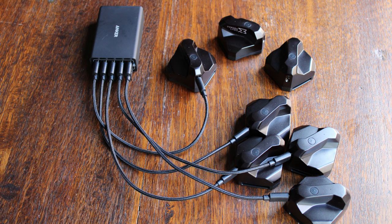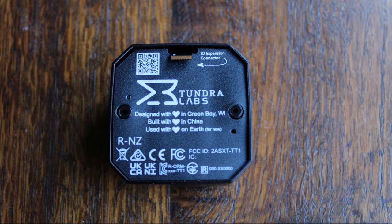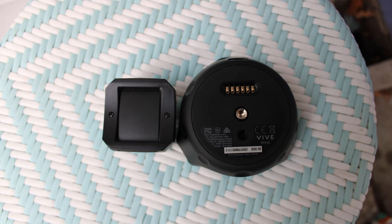The cables are very short though. This is nice if you have a USB power supply where you can get all the trackers close to it, but it might give you trouble with setups where you can't. Flipping the tracker upside down reveals two Philips 00 screws that hold the base plate. Under the base plate is the battery cover and a ribbon cable for input and output — this is what the pins on the Vive trackers are for. There's no base plate with these pins for the Tundra trackers just yet.